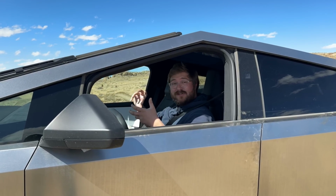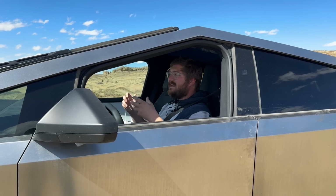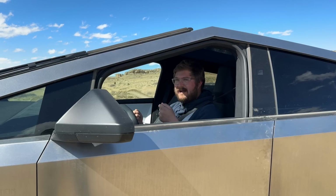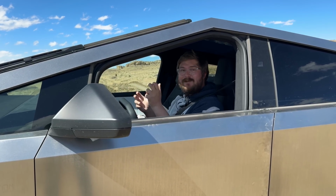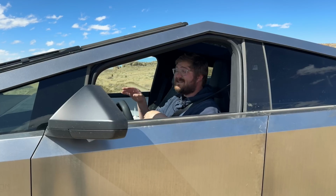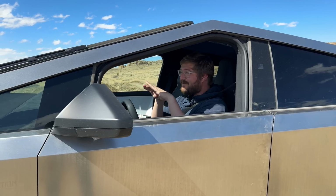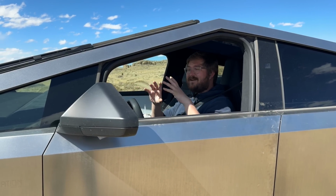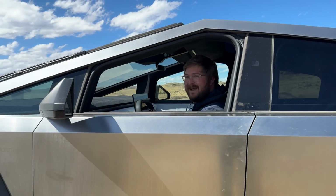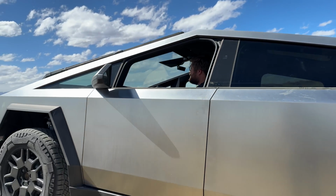And being the tri-motor system, that outside tire is getting some traction. What becomes a problem though is when you're on split mu constantly changing, the software has to keep up with what's happening. And you'll notice that even though I'm going this slow, it doesn't quite keep up. It kind of stops for a second and I'm hard throttle and then it goes, oh, here's what's going on, and goes. But this is better logic than even I expected this early on. I'm pretty pleased with this. Let's just do it again.